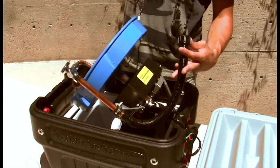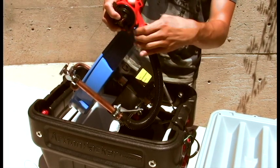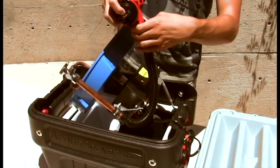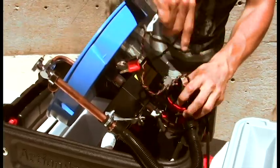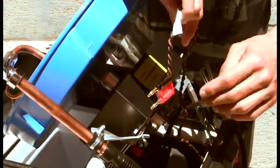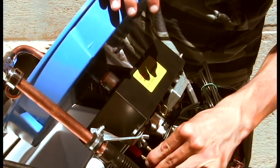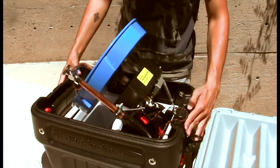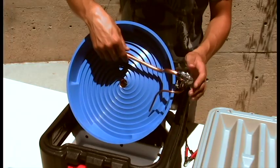Next we'll connect the water pump. The hose from the spray bar assembly twists on — make sure that is connected securely. When putting the pump into the container, make sure the filter is on the bottom. Next, connect the two electrical leads to the back of the drive unit: red to red, black to black. Fill the container with water to the bottom of the PVC frame. Make sure the power switch is off and attach the leads from the drive unit to the battery: red to red, black to black.